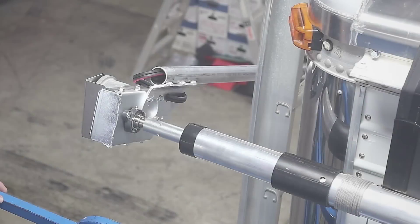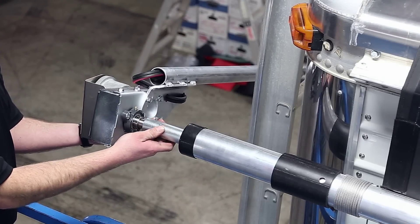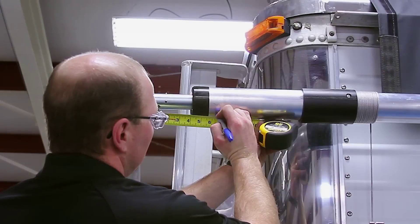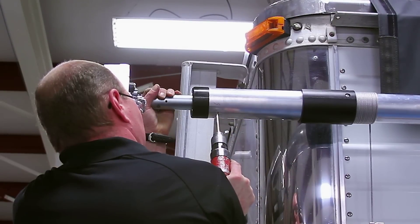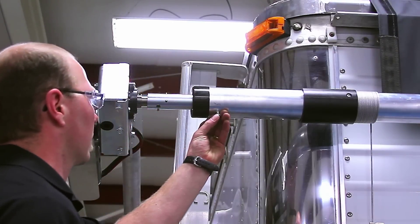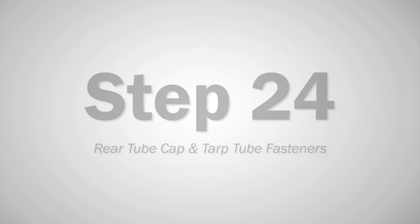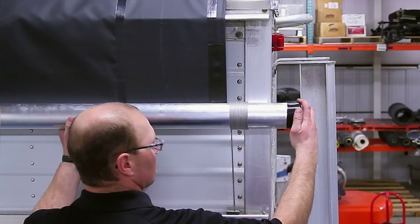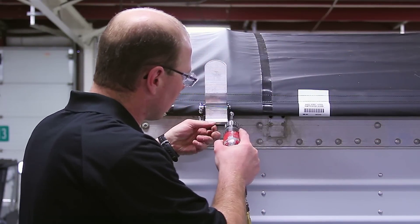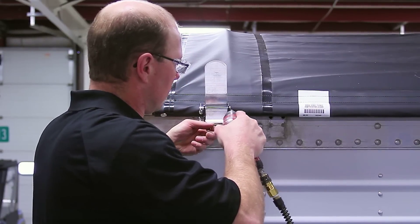Step 23. Square the motor pivot arms with the roll tube by adjusting the drive cartridge in or out as needed. Measure 180 degrees opposite of the rope channel and mark 6-1/2 inches from the beginning of the drive cartridge. Then drill a 5/16-inch hole through the roll tube and first wall of the cartridge inside of the tube. Insert a 5/16 by 9/32-inch drive rivet. Make sure rivet is fully seated, then set with hammer. Step 24. On the back of the trailer, install the black cap over the end of the roll tube. At one of the tarp stops, install two Phillips head self-drilling fasteners, one on each side of the bracket, through the tarp and into the fixed tube.